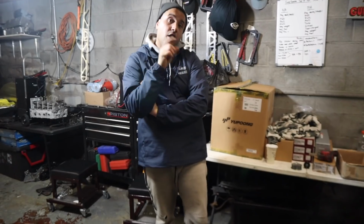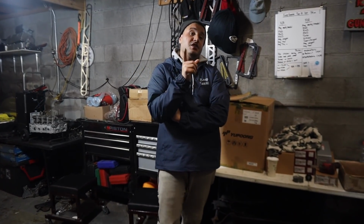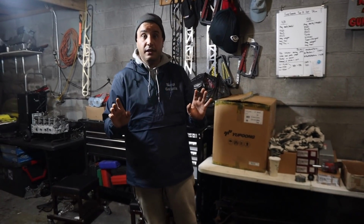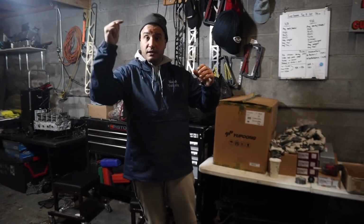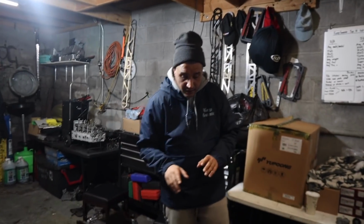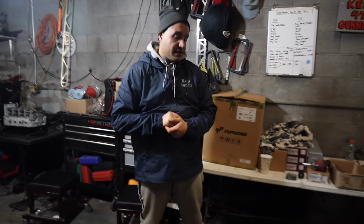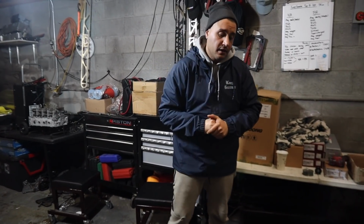Everything is going good. Hopefully that MX-5 steering rack and pinion is going to be just a bolt-on type of thing. We can fill it with fluid, turn it left and right, loop the hoses, and plug one port. And we're done. Collins is sending us another adapter. He's also sending us another slave cylinder. I'll explain to you guys the difference once we get all of that.